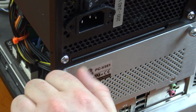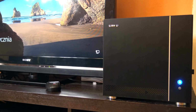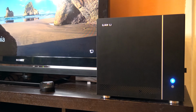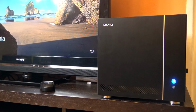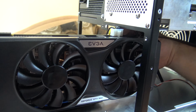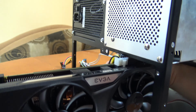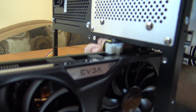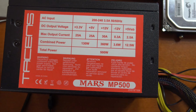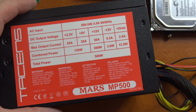In order to be sure what kind of power supply you will need, you need to know what components you will have, especially the GPU. The graphics card can limit your case choices, especially if you would like the computer case to be a small one. Some cards are tall or long and they will not fit in smaller cases, or they will basically just make your building experience a nightmare.